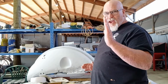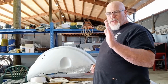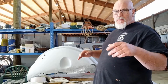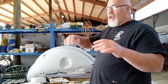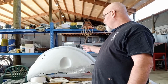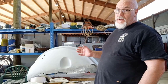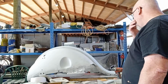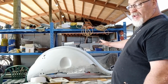I will chamfer them back once I'm happy with everything. I will put the paper in there on a little bit of angle and just rub it off so it chamfers back, and then hopefully by the time I put a couple of coats on there, it'll smooth the transitions out a little bit, and then we'll just rub it back lightly. And then hopefully after the last 2 coats, rub it back lightly, and everything should be all nicely blended in. Because I've had a guts for these front fenders, but they have been probably the worst thing I've ever sanded or worked on.